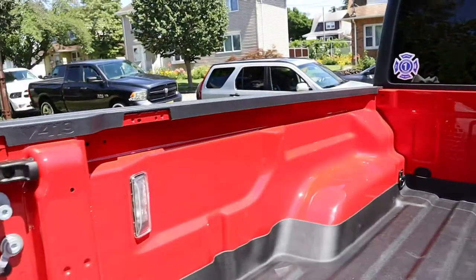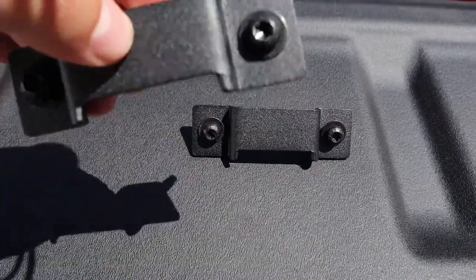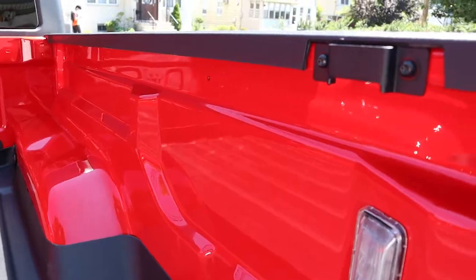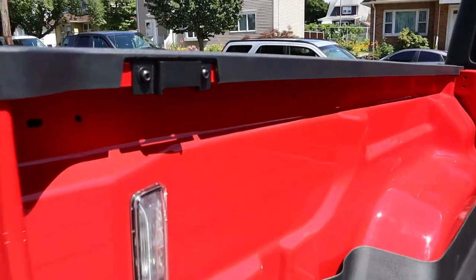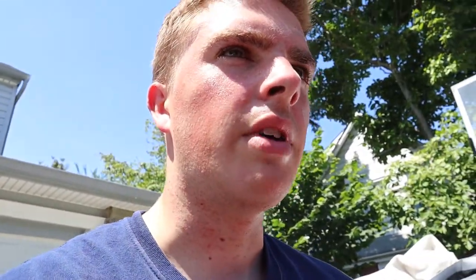After you've got those pieces cut out, here are your two brackets with the screws. There's a notch where the clamp sits under, so that goes down this way. The back brackets use T30 bolts — they take a little bit of work to thread in because of the painted truck bed and the spray-in bed liner coating within the threads, but as long as you use a ratchet and take your time, it's perfectly fine. The expansion nut goes in the top hole and the bolt goes in the bottom, tucking under the bed cap.